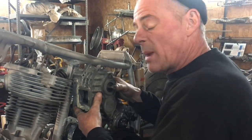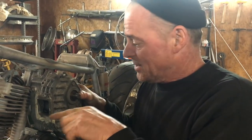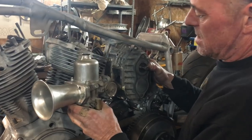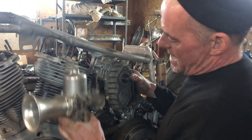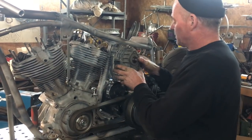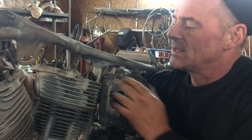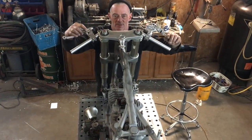I've got this little gear reduction — I think it's out of a Toyota — which means having a Toyota part on there increases my reliability of the motorcycle a thousand percent. A few people have asked me what's the difference between a supercharger and turbocharger. Well, this one's super — as in supercharger, a lot of you know. So we're going to run that there and run the SU. Get that snout tucked in there. We're starting to get crammed for room in here. So we'll get the SU in there, drive system off here. I'm going to overdrive it a little bit, and we're going to run an intake plenum around here into this side.